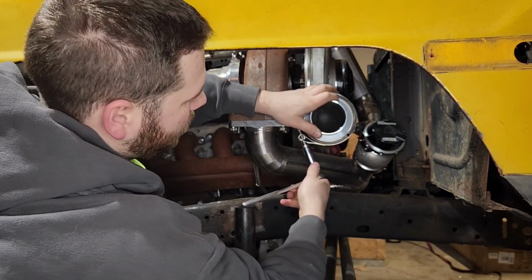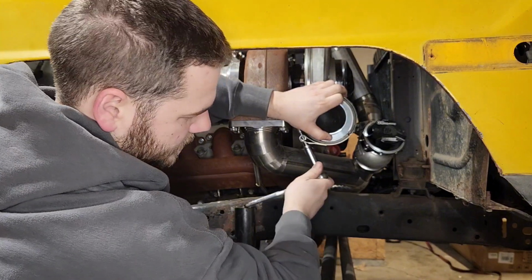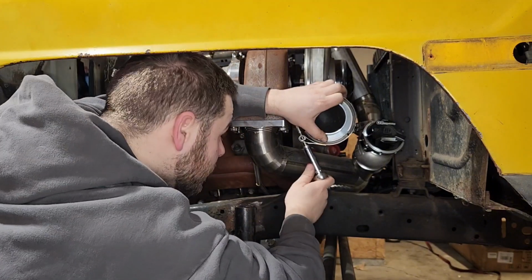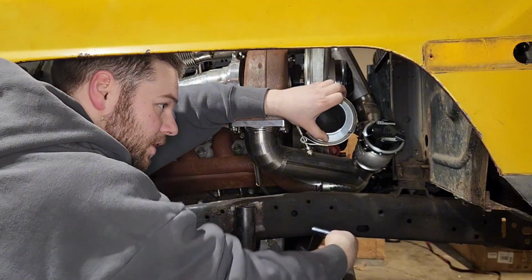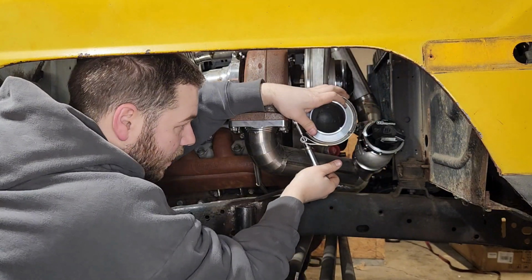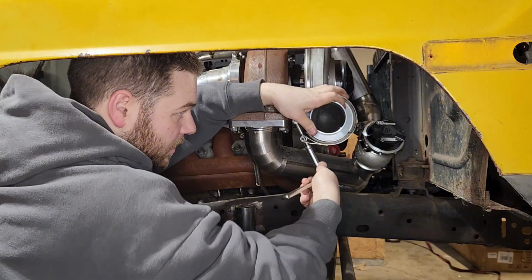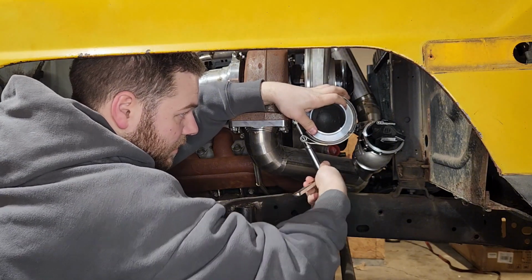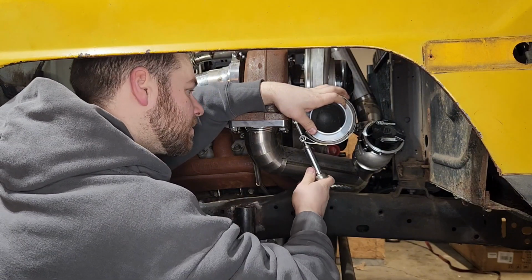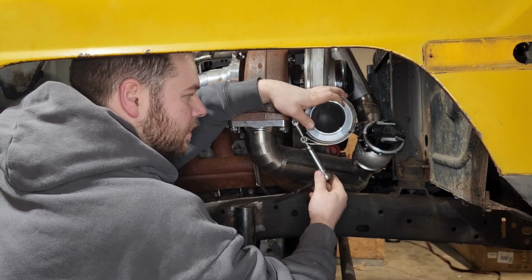The other thing in this wheel well I've got to be cautious of is tire clearance. I want to keep this truck nice and low for the turning radius here, so I might have to come up and in that way, but we'll get a tire in here and check clearances also for this fit up process. That would really suck. Build it and then all of a sudden you've got to limit your steering radius or have a truck sit higher than what you want.